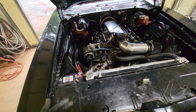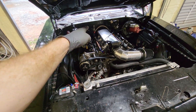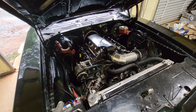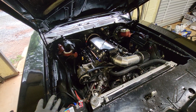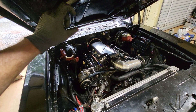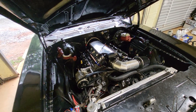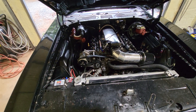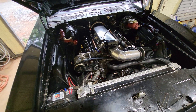The battery cables weren't long enough, and just a poor installation overall. The dipstick tube — they actually took a real metal dipstick tube, cut it, hose-clamped some heater hose to it, came up and shoved the top piece of metal on and clamped it with another hose clamp. Now that we have the correct dipstick tube in it, it's not even touching the stick, so it was showing it had fluid before.